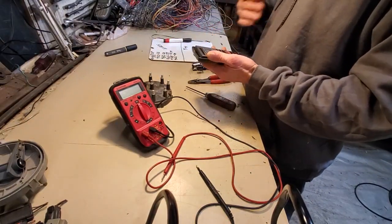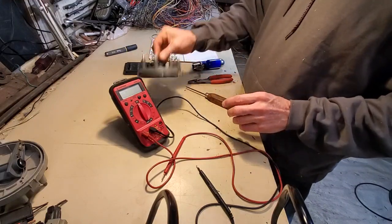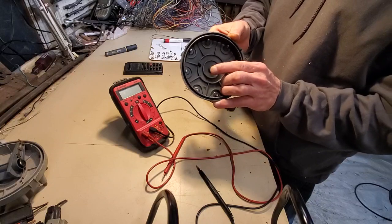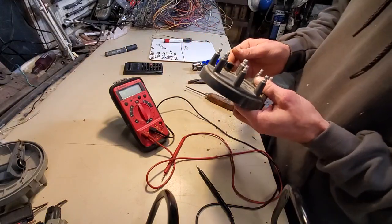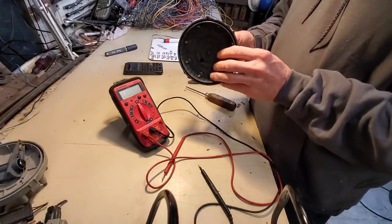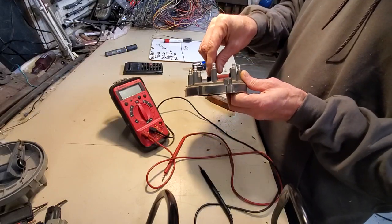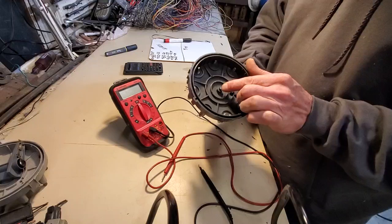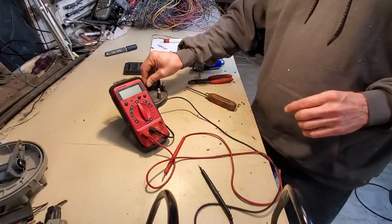Yesterday I uploaded a video about testing spark plugs and wires and the distributor cap, and this guy here was not reading a consistent resistivity from here to here. It was all over the map, anywhere from 50 ohms to 350,000 ohms and so on and so forth, and the new cap was reading about 7 ohms while I was attached to the coil terminal point where the coil hooks up, and measuring to this button while the button was depressed, and I was wiggle testing to check for intermittent connections. The new cap performed a lot better.